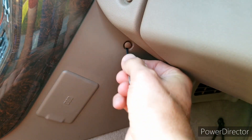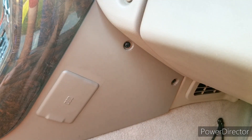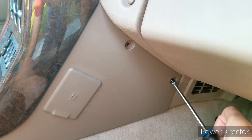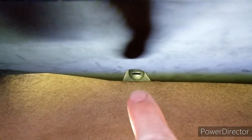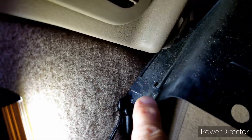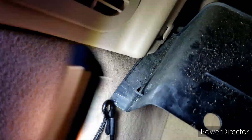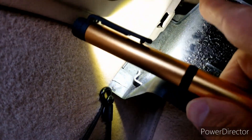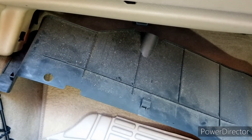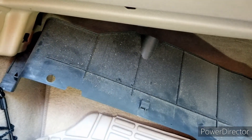Next step: remove the plastic covers from the screws. I'm going to link you to a different way to do this in the description, because the way I did it didn't work out that well and I wouldn't do it this way again. But once you get those covers off, undo those two screws between the center console and the glove box enclosure. Next, way up under the dash there is a black trim panel held on by trim panel retaining clips. There are three of them, and those clips are very simple — you just turn them 90 degrees and they slide out. On that trim panel itself there are two small hooks: one on the left side that hooks into the glove box enclosure, and you need to be careful of that when you're lowering it. There is also another one in the center that hooks to another part of the glove box enclosure.